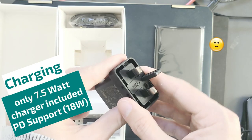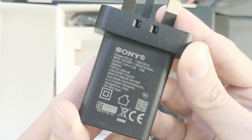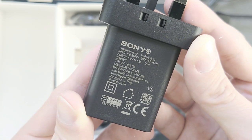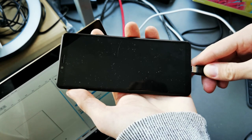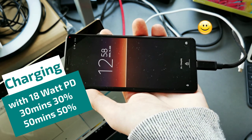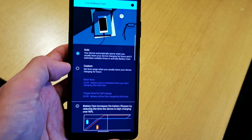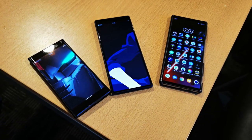The more I am disappointed by the power supply Sony delivers with the Xperia 10 Mark II — 7.5 watts charging is abysmal even for this price point. The phone can actually use an 18-watt PD power delivery charger, which gives 30% power in 30 minutes, consistent up to roughly 90% where it slows down. This is Sony's battery stamina charging technology that preserves the battery by charging the last few percentages slower than usual, and based on my experience with older Sony smartphones, it does help keep the battery healthier for longer.